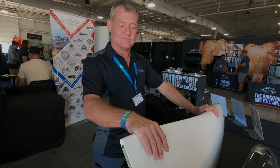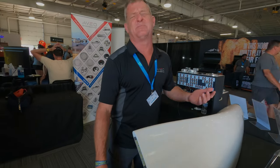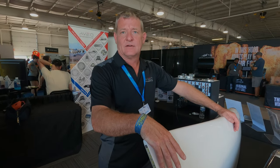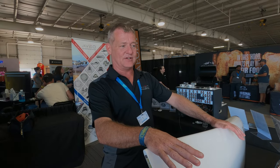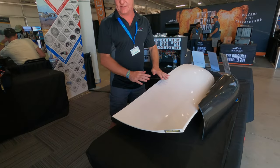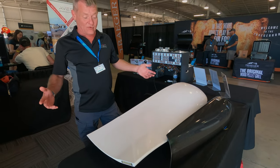And what does that do for people? It eliminates wingtip vortex drag. So obviously you're going to get some small modicum more top speed, not much more than a mile an hour. And doesn't that do something to the stall speed? Well, it lowers the stall speed, reportedly about one knot less stall speed, and also gives you a little bit more aileron control authority, as it tends to corral the wind flow over the aileron a little bit better. Instead of it sliding off the end of the wing, it tends to, I mean, I don't have much in the way of technical wind tunnel proof of this.